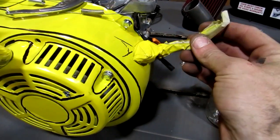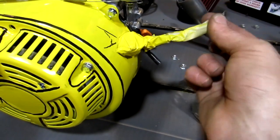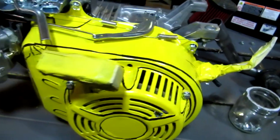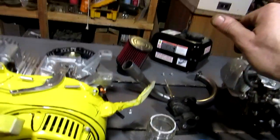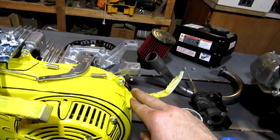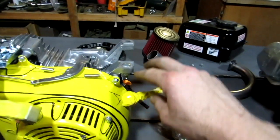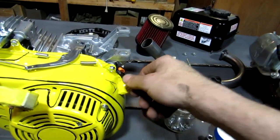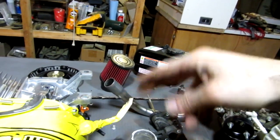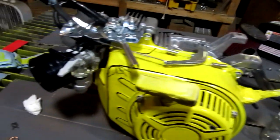I went a little ahead of myself — this is the ground wire and it's got a little connector that's going to connect to that bolt, but I'll wait to do that. Because I think I might put a switch up on top that comes down in line with this, so if I ever take it someplace and don't want people to take off with it, I can reach inside and turn the switch off. If people try to turn it on, there's still no connection to start the engine — two kill switches.